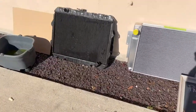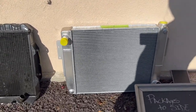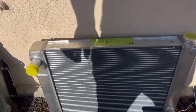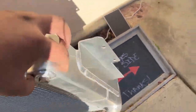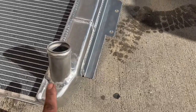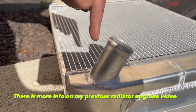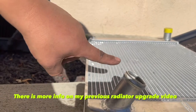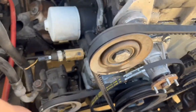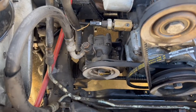As far as I remember there's nothing else in the way. So that's the Montero radiator I actually upgraded to originally, because I kind of screwed up and didn't prep for this one correctly. One of the main things I did have to do when pulling this out was readjust this, because originally it was coming out straight — sticking out up and down right there, 90 degrees, going out to about there. The issue was it stuck out to about right here, so it was gonna have trouble fitting with the power steering pulley.